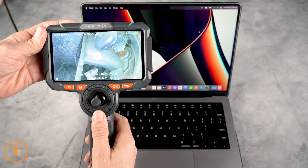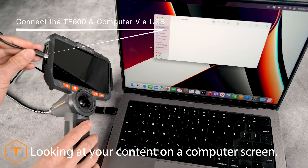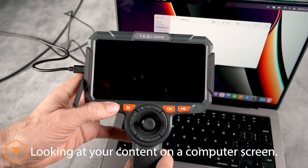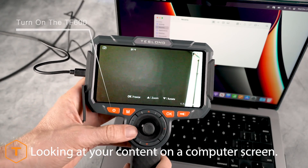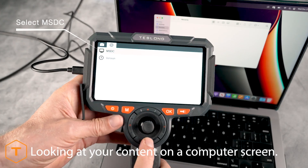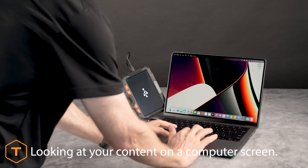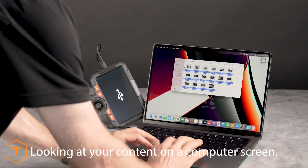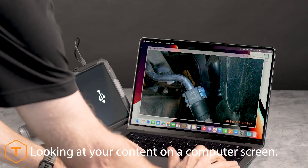If you want to move your photos or videos to a computer, there are two ways to do this. The first method is to plug the TF600 into your computer with the USB cable, just like you are charging it. Note the monitor needs to be turned on to see the files on the computer. Press the settings button twice and scroll down until you reach MSDC. Press OK twice and you should see the USB drive symbol on the monitor and can navigate to the drive folder in your computer's finder. You will see photos and videos from the device stored there and can drag and drop them onto your computer.